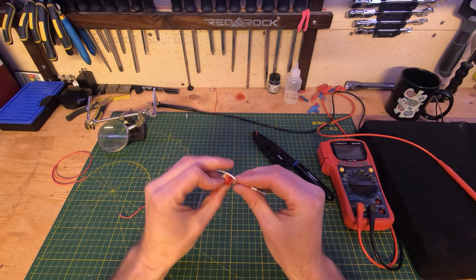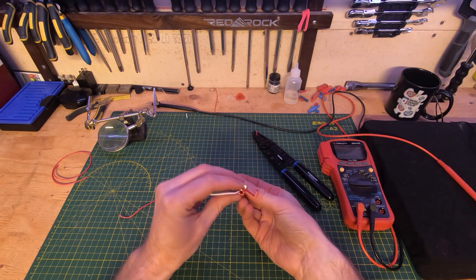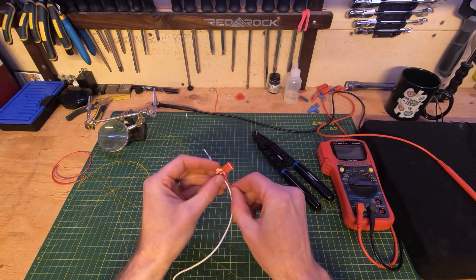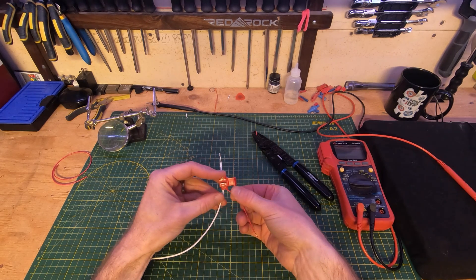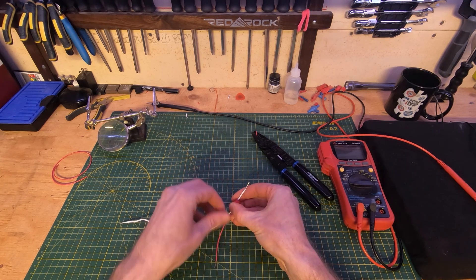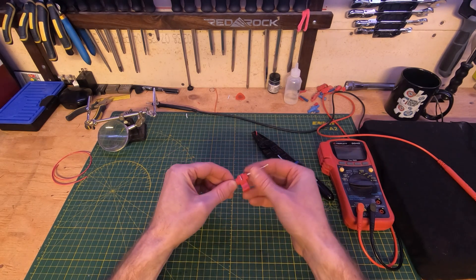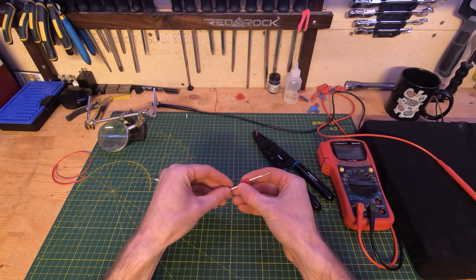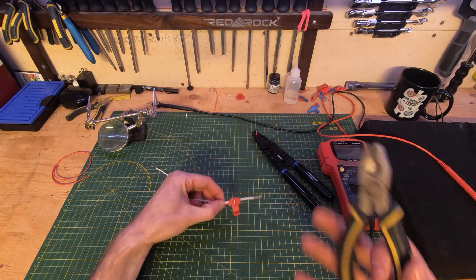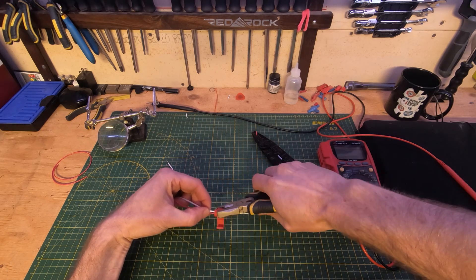You set the main wire inside like that — see how it goes all the way across — then lay the tap wire inside too. Once you've got all three in there, hold them in place and crush the blade down. Now that's the reason I don't like the T-tap splice: it actually pretty much breaks the tapped-into wire. It's going to do the job for sure, but it's not ideal.